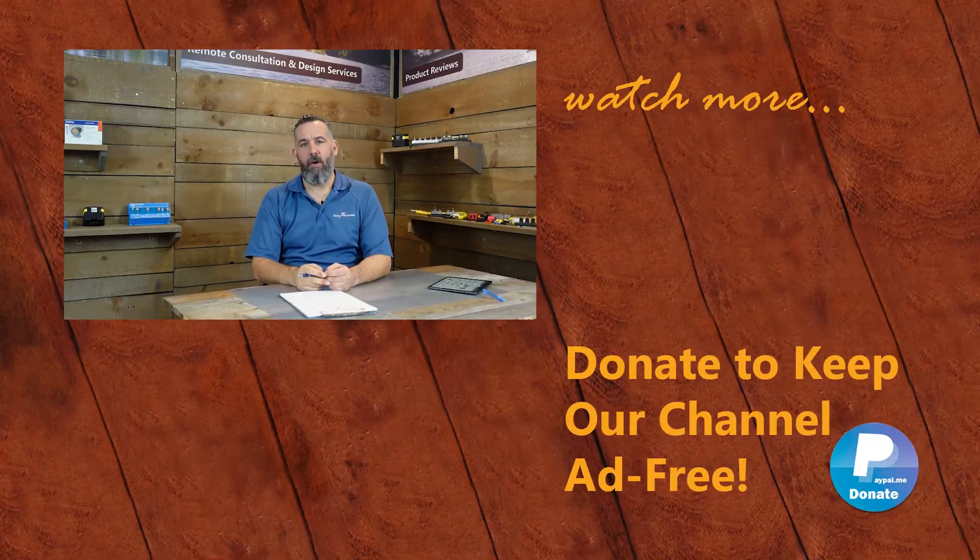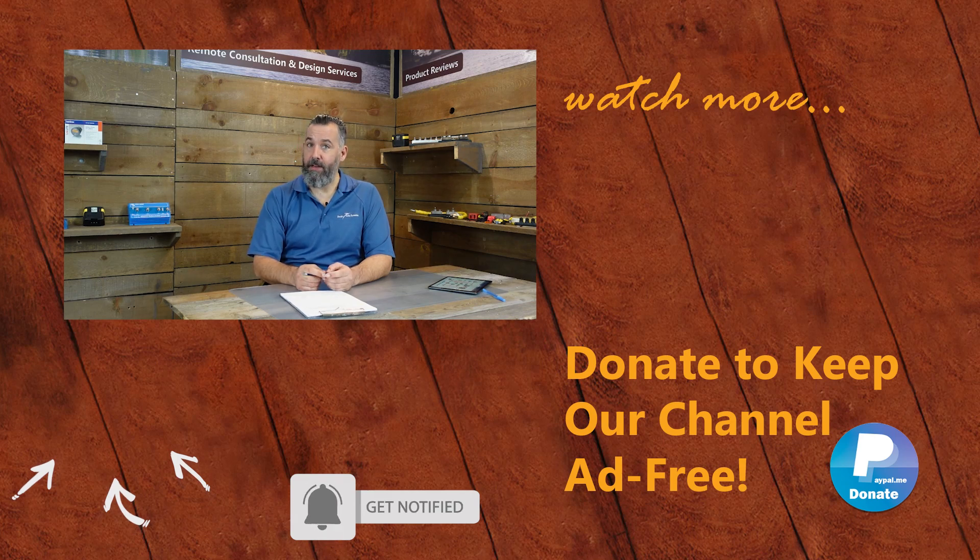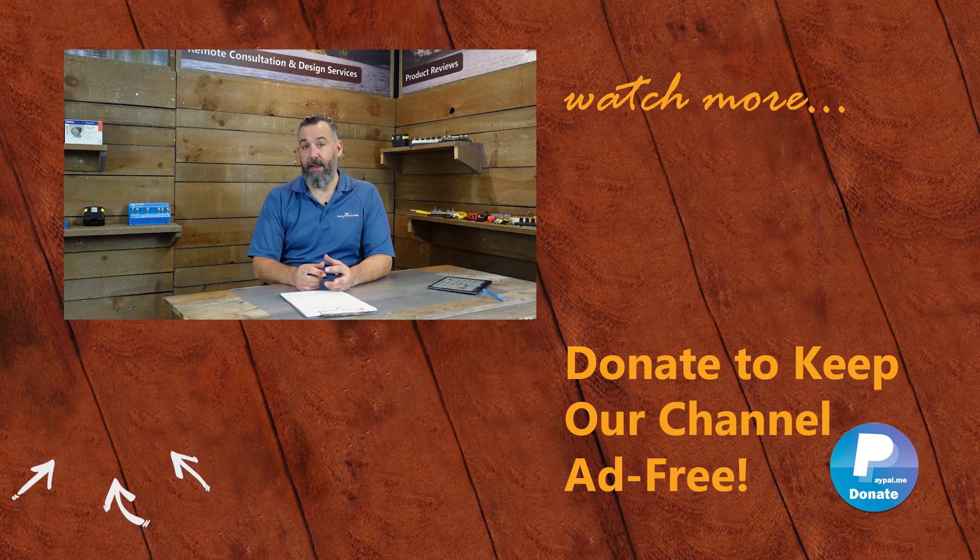So there are two ways to handle this: have your alternator go directly to your engine battery bank with a battery combiner going to the lithium, or have your alternator go to a battery isolator connected to both the lithium and the AGM battery. Gary, your questions show you're doing your homework and I bet this project will go well. Thanks for watching. Please ask further questions below or via our contact form, and don't forget to subscribe.